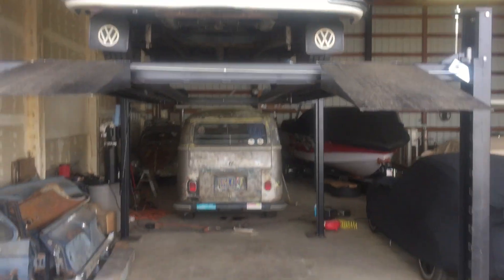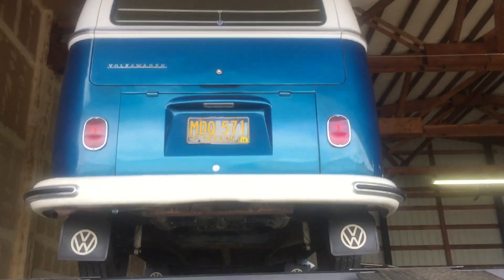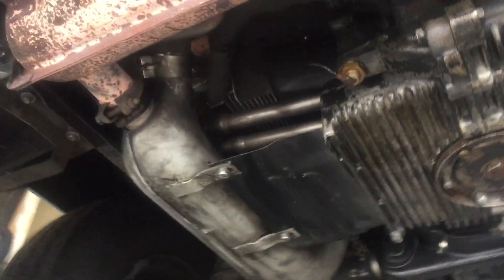We have the 1965 13-window Deluxe bus up on the hoist. I want to show you some of the typical trouble spots on most of these buses that have rust. This bus is a great example of an original one because it doesn't have those problems. Here's the passenger side corner — you can see the bottom of the corner is rough and holey on a lot of buses. Underneath this panel right here, no rust. This is the battery side tray, which is the more typical side that has problems. This one has had a little bit of repair in the battery area because batteries give off acid vapors and cause rust. That is the only rust or rust repair I found on this bus.